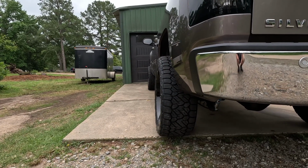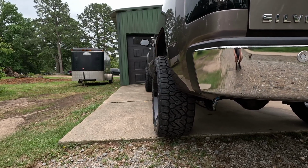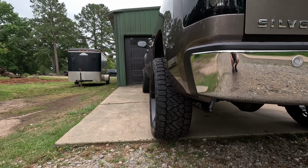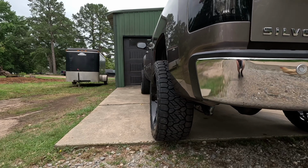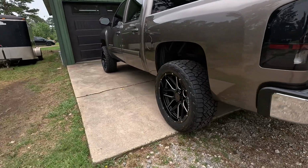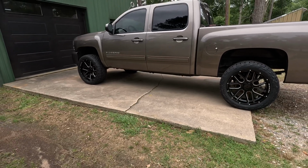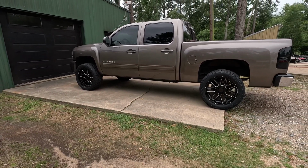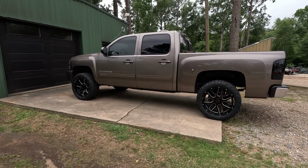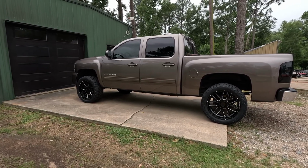And the tires, being a 305 wide, are nice and wide. They're rated at 32.8 inch tall and 12 inches of width. And I would say the width is about right. On the height, on the tape measure, they come out to 32.4 inches tall. And that's not uncommon for things to run a little bit small. On a lot of your 33 by 12.5s, I put a tape measure on them whenever I do the tuning on those trucks. And oftentimes they only measure 32 inches tall. So they're a good bit shorter than 33 inches.